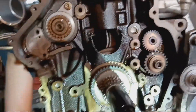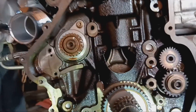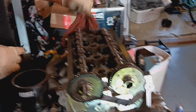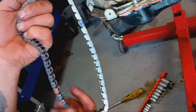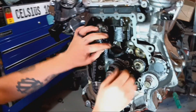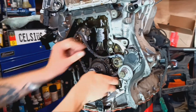A lot of people ask where the actual timing marks are. The biggest thing is everything is marked — the chains are marked, the gears are marked. The only thing to be sure of on the crank when you're messing with the cams is you can see the connecting rod on cylinder one. What I normally do is pull it back just off top dead center so you know when you put the cam cap back on, it has full clearance of the top of the piston. You have all three marks lined up for the chain. The chain has a bunch of different marks — do not pay attention to the copper link. Pay attention to the three single black links. The spacing on the links is the same, so it doesn't matter which link you put it on as long as they're lined up to the timing marks.